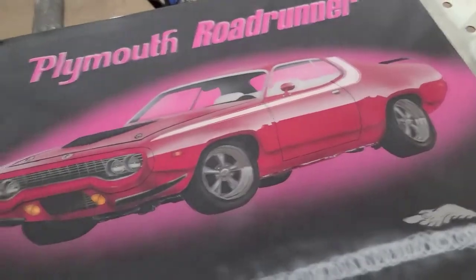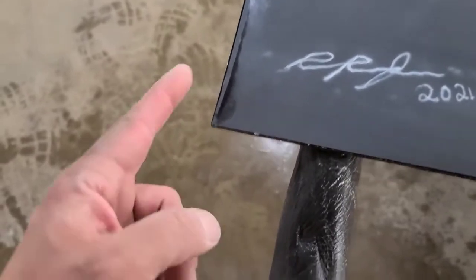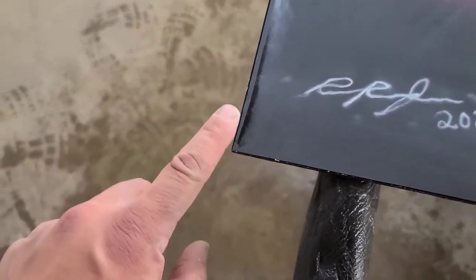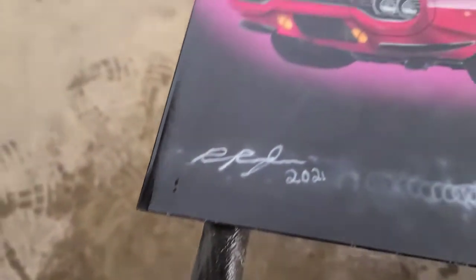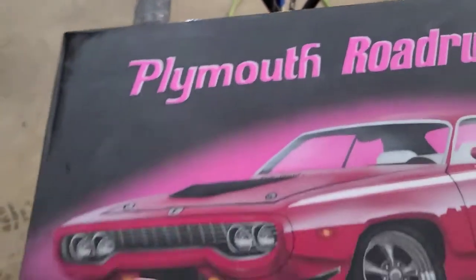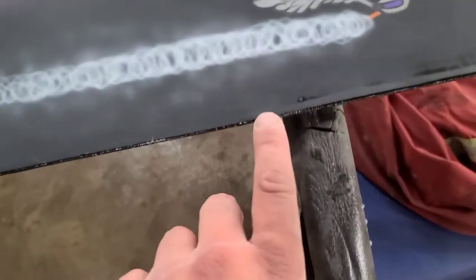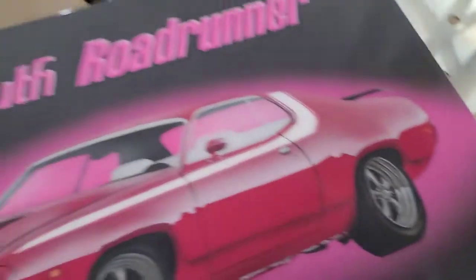I have a lot of clear on here so I'm not worried about burning through. If you've never done it before it could be a bit intimidating. You can see my edge where the paint built up — because of how thick I put the clear on, it's thicker on the edge than over here. That's why I've got this little clear line there where the sandpaper hasn't flattened it out yet. Same with up in the corner — I'll keep going to knock that out and flatten up these corners.